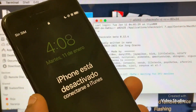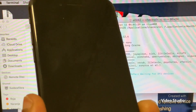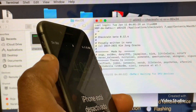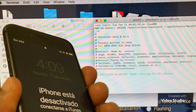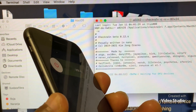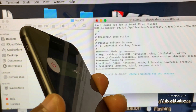So here is the phone — iPhone 8, iOS 14. You press volume up once, volume down once, and you press the power button. When you see the phone go off, then you press the volume down together with the power button, and you count to nine or ten.